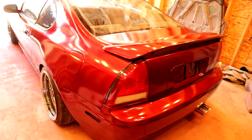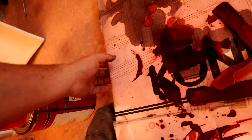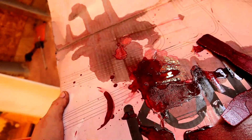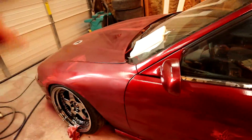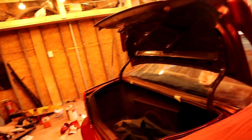I'm going to start wet sanding, wait for Cal to get here, then continue wet sanding. I tested by dumping some of the clear out onto the paint that fell onto this yesterday and it's not pulling any of it, so looks like we're good to spray. Almost done wet sanding — I have to do the rest of this door, this side skirt, this pillar. Cali's going to take care of the drip parts while I tape the rest of the car off. I did test out the clear right here and it doesn't seem to be reacting yet.